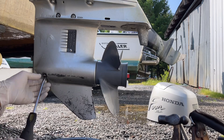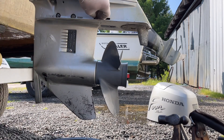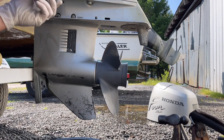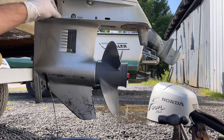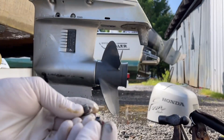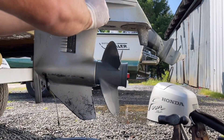So I go ahead and pull the bottom screw. Just make sure when you pull these screws that there are two screws — one has a magnet and one does not. The top one with the magnet goes in the bottom so it catches your metal shavings. It is a dog clutch gear system and that's just how it goes — you get metal shavings in the oil. I'm just showing you the gear oil screws so you don't mix them up; the longer one goes in the bottom.